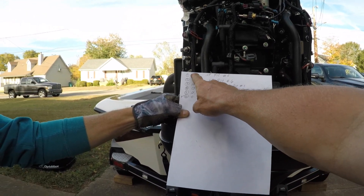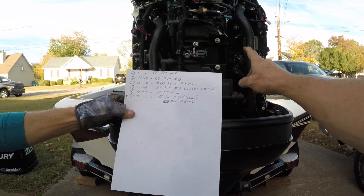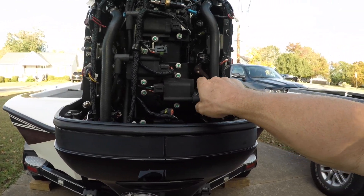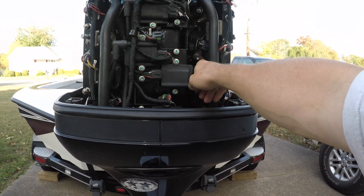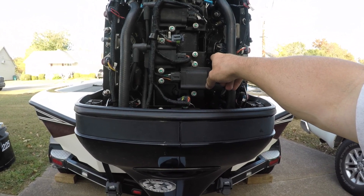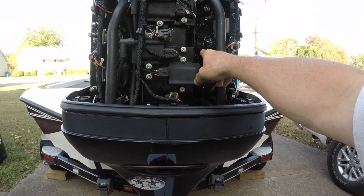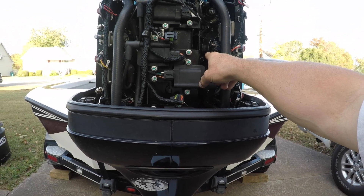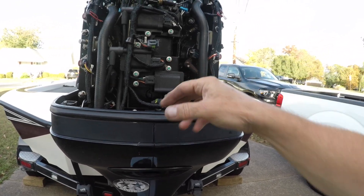The other thing you want to check is your wires. Your wire has a diode in it, so you're going to have resistance just like a diode — something like 0.77, or a diode test of 0.336. If you put it on continuity, you're not going to get continuity because it's a diode.